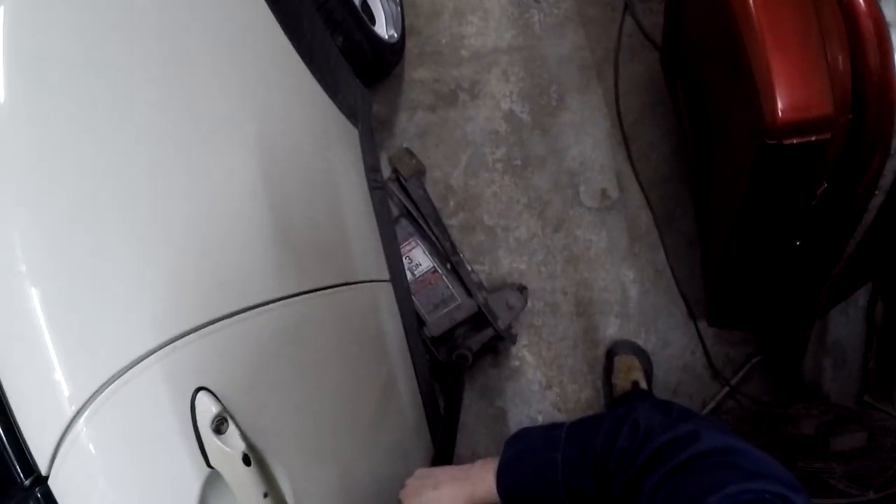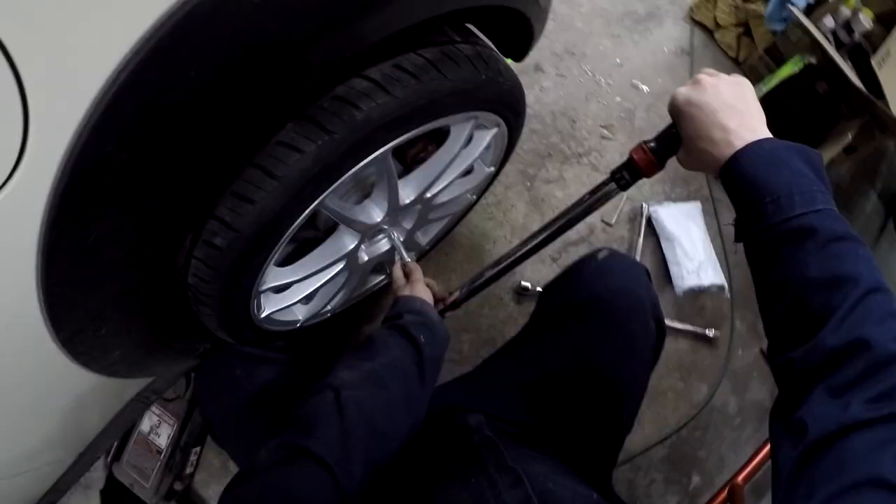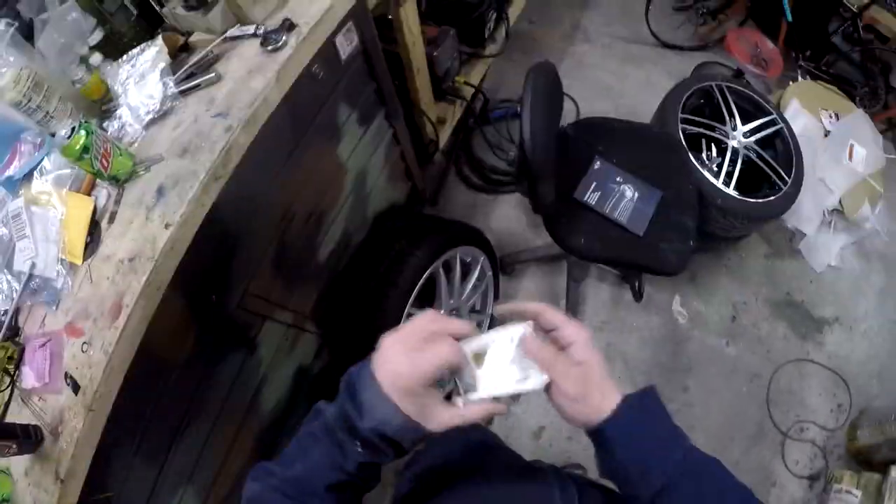Set this one down. Now according to tire places, after about 60 to 100 miles they want you to come back and re-torque them. I'm not going to a tire place, so I am going to re-torque them in about 100 miles. The reason being: all that shrinking and stretching with brand new parts — they can find their own settling point. One might come loose, and if one's loose, that can throw off your balance, handling, or warp your stuff — and none of those are good outcomes.